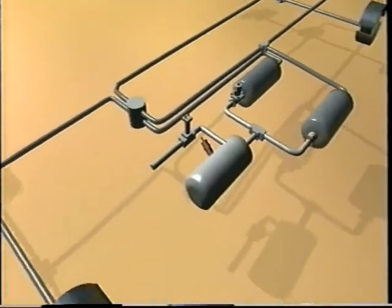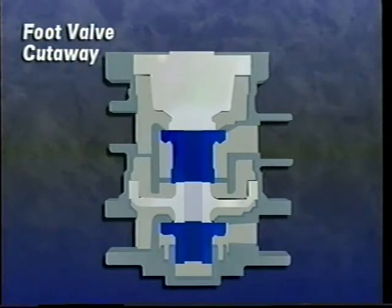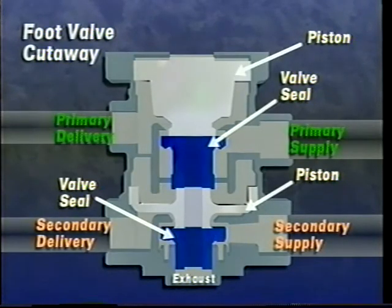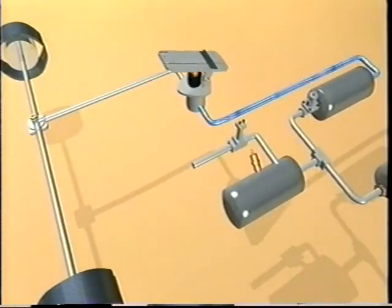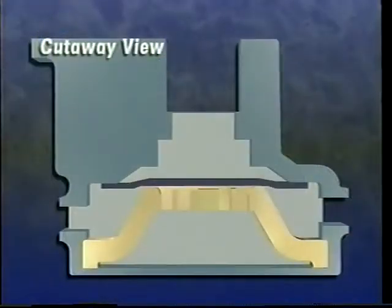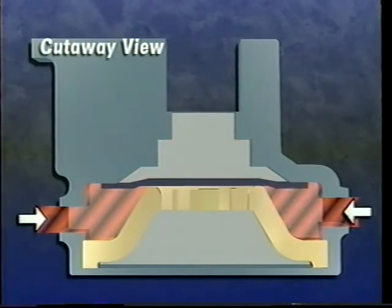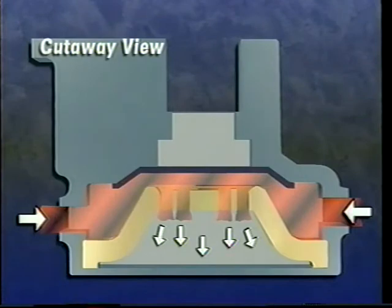Now let's look at the secondary and primary systems. Typically, the secondary system controls the front brakes, and the primary system controls the rear brakes. The dual-circuit foot valve is a key valve in both systems — it separates and controls the primary and secondary brake circuits. Dual-circuit systems are required by law to protect the braking system from complete failure. When the brake pedal is depressed, air from the secondary tank flows through the secondary portion of the foot valve to a quick-release valve and applies pressure to activate the front brakes. A quick-release valve speeds up brake release time by exhausting air near the actuated brake. The exhaust function is activated when the driver lifts his foot off the pedal and air flows back from the air chambers to the exhaust port.